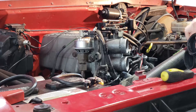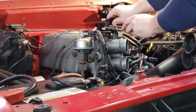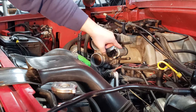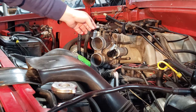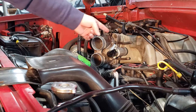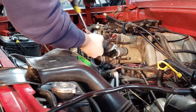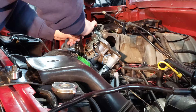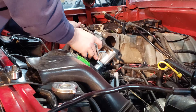Set them off to the side here behind the radiator hose. Next, I'm going to pop off the throttle cable — just taking a flat head screwdriver underneath it and gently prying it off that nipple. Also keep in mind that if you still have your evap lines on here, you may need to take them off since I don't know if it will be able to bend around where you're going to be setting your throttle body. My evap does not work, that's why mine is unplugged. Grabbing a 3/8 socket, I'm going to take off the bolts. Then you can pivot the throttle body just up and out of the way, making sure it's not damaging the idle air controller or any of the coolant lines as you tip it over.